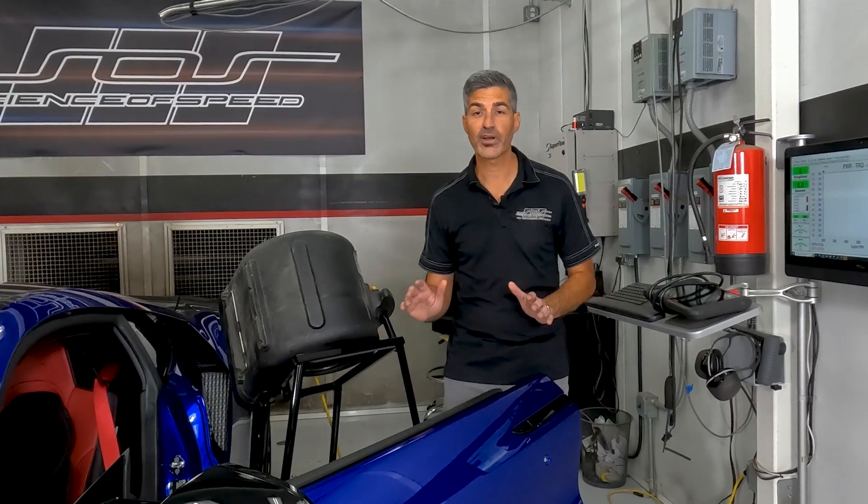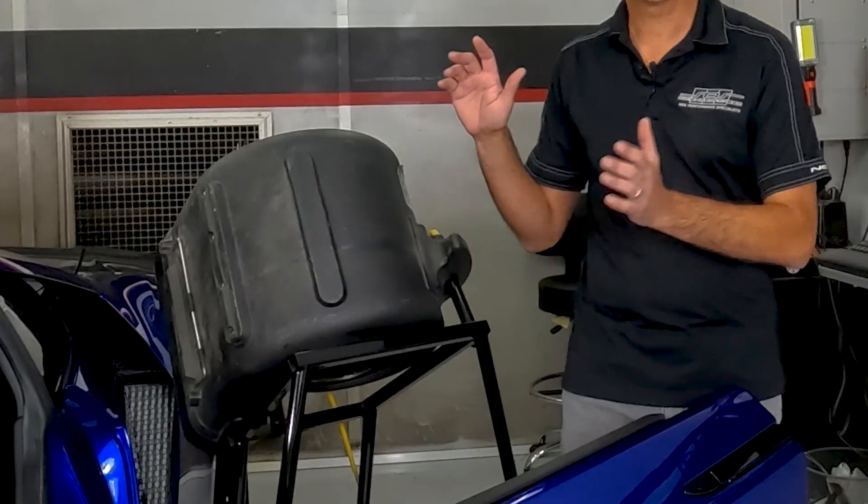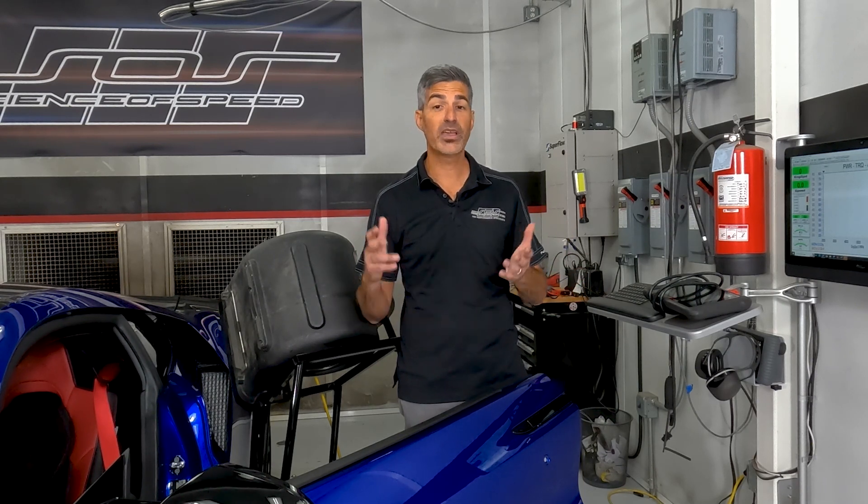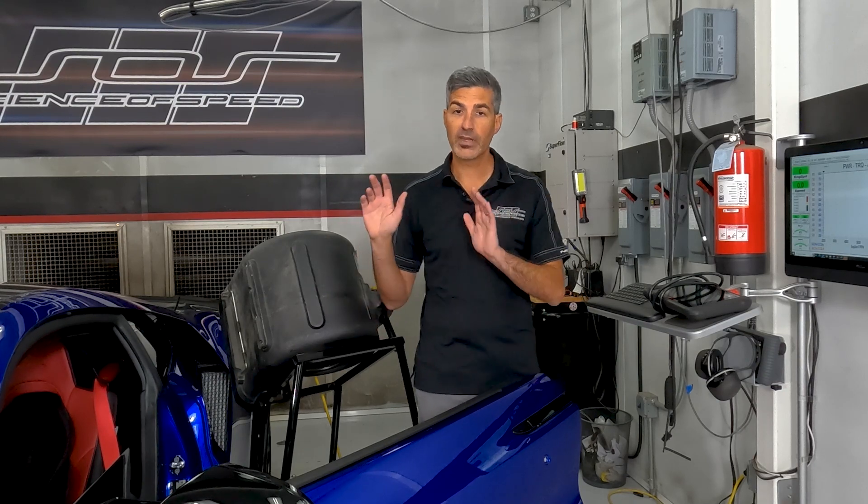Next, a significant amount of airflow is required to keep the NSX temperature stable. We have over 76,000 CFM of airflow in this test cell. In addition to the exhaust ventilation fans, we have spot cooling on the front of the chassis, on the intercoolers, and on the engine itself. One of the most crucial areas for spot cooling is the intercoolers. These blowers are mounted on custom-made stands and even these blowers only replicate about 30 mph of airflow. Unfortunately, most shops aren't going to have this and you may need to improvise, but you will not get reliable measurements without cooling the intercoolers.